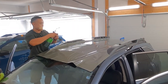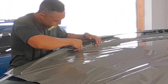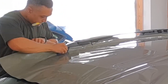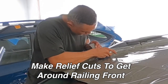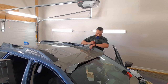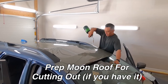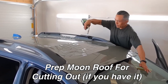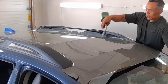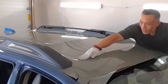I was doing this in a very hot garage — probably about 90 degrees Fahrenheit — so the vinyl adhesive, which in this case is Vivid heat-activated, was very very sticky and grabbing on everything. Working my way in towards the inner rail, tucking the vinyl against it, and once I get close to the front side I'll do the same thing as the back: make a relief cut so the vinyl drops down over the part of the roof that goes over the side of the railing in front of it, past the drip sill side. My car has a moonroof and I have it open ahead of time, so I'm heating all that vinyl — you can see it's shrinking and essentially glassing itself out.